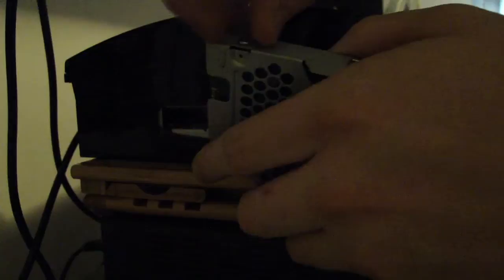Alright, so it's shut off. Just unplug it from the back to be safe. On the left side there's a plastic casing — easy enough to pop off with your fingernail. You'll normally have three screws: two silver screws that hold the hard drive into the bracket itself, and one more that holds it into the PS3. I've already got mine taken out from a couple of attempts to make the video. Before you take out the silver ones, slide it forward and pull it out — it's pretty simple, though it's really hot.